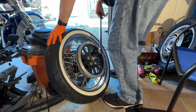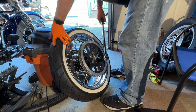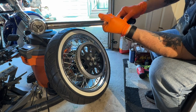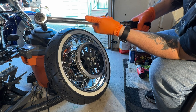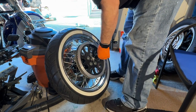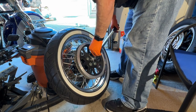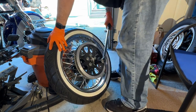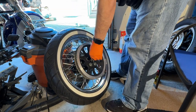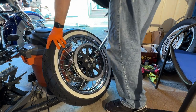So I got all five of them at 65. Now I'm going to unlock it and just go up to 70. And that is 70 pounds — again we'll start here, go here, here, here, and finally here. You want to make sure you got them all — I like to just go over to make sure I didn't miss any. Believe me, it's worth it. It's your safety — it's your life.